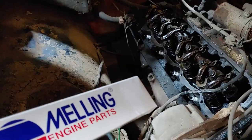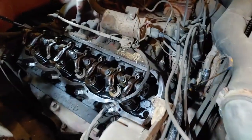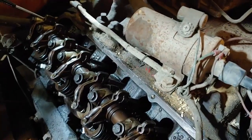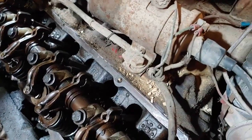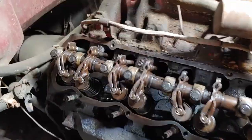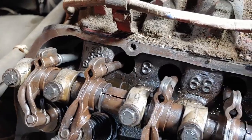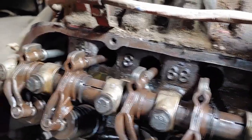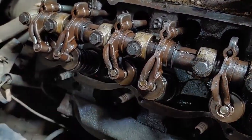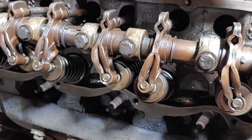I'm going to get this put back in because I really want to hear how this thing runs with all the push rods in it. The new push rod is in — getting that lifter back in the hole down there wasn't easy, took a while, but it's in. I loosened these up just enough to lift that up a little bit, then retorqued the bolts to 25 foot-pounds.